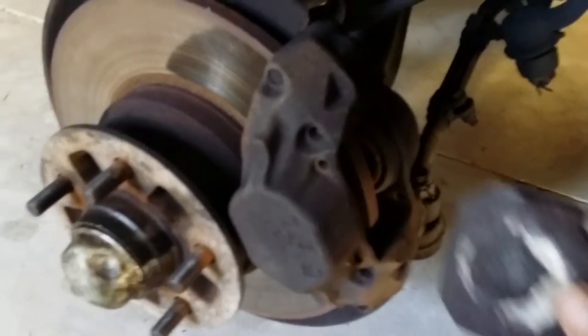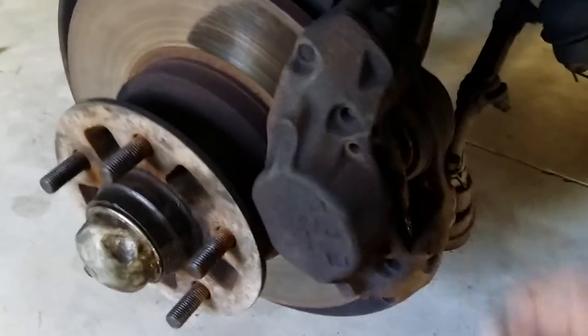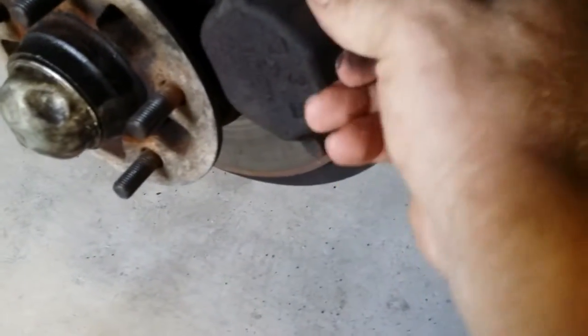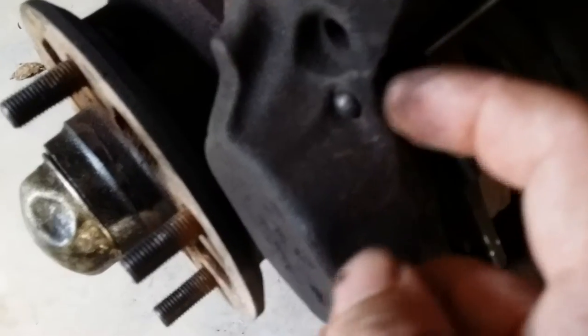These brakes are pretty simple. Brake pad goes in here like so. This one would go in like so — of course right now it's cockeyed because I got it loose. And then the pin would slide through the hole, go through the brake pad, into the other side, all the way in like that. And then inside there is that little hole, and you just put a little tiny cotter pin in there. You just bend it over and that's what holds them in.